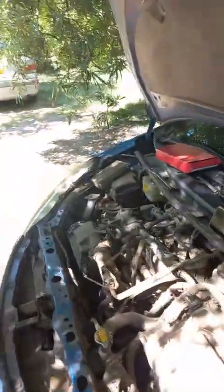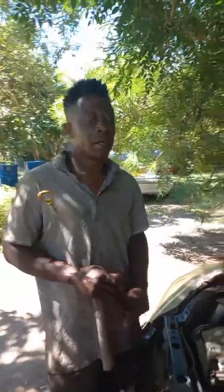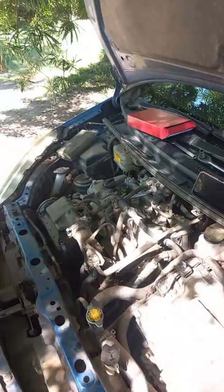Use the plugs recommended for your car. If you go to Transave, they've got all the specs of mostly which plugs go into which car. You discover, like, when you go to these Toyotas, especially the old Toyotas, there are BKR 5E, 6E, 6EK, 6E-11, 6EYA. All of these things mean they are for a particular motor.